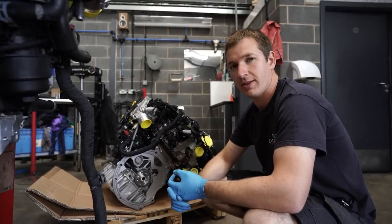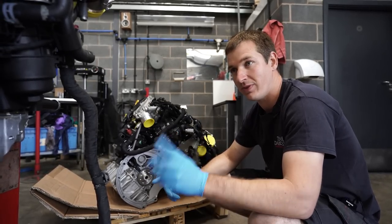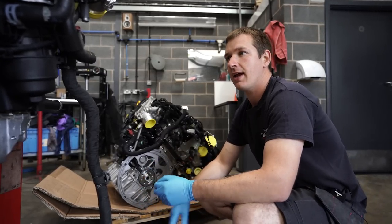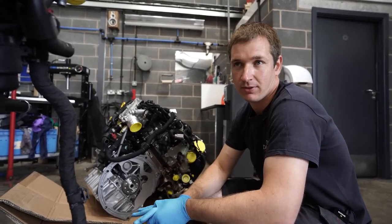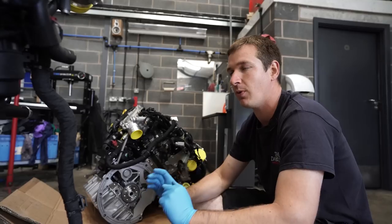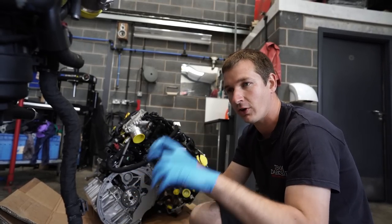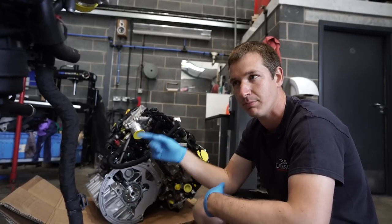But we've also been looking at the data, and the gearbox oil's getting up to about 135 by the end of the, when the engine failed last time in the Golf, it was about 135 degrees, if I remember correctly. Out of 130, we're worried. We've not had a failure this year yet, but it's going to happen at some point. We've done a few little tweaks internally, and I think we've got it pretty much nailed. But we said, while we've got all this complicated stuff going on, we're going to have a gearbox cooler. I'm going to tap into the gearbox and put the oil drain into the right place, because before we just had it tipping in, and I think we were moving the oil where we needed it and putting it somewhere we didn't.